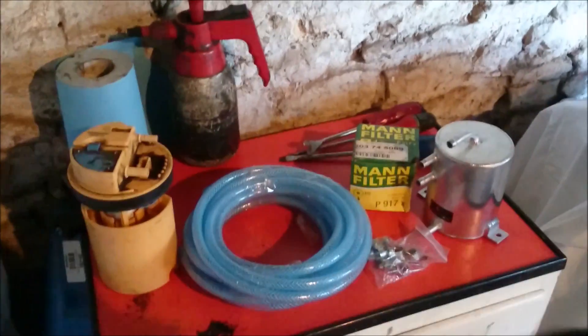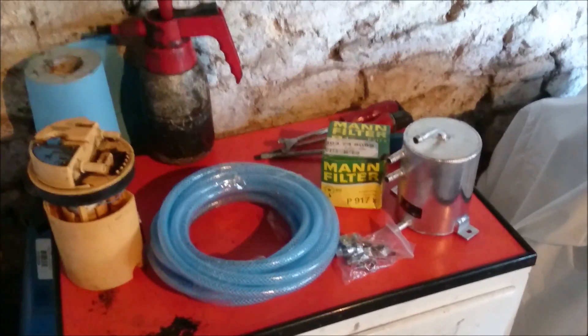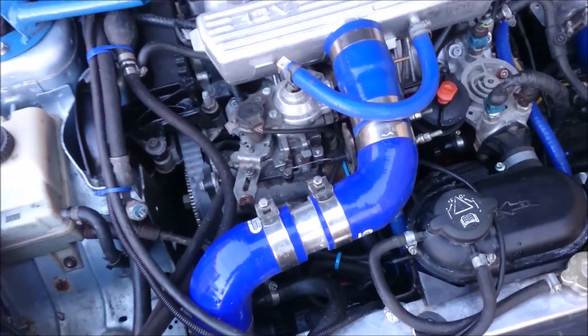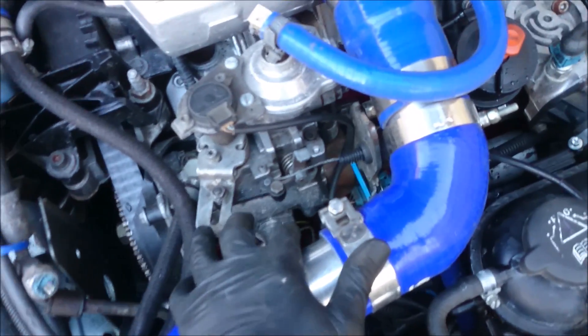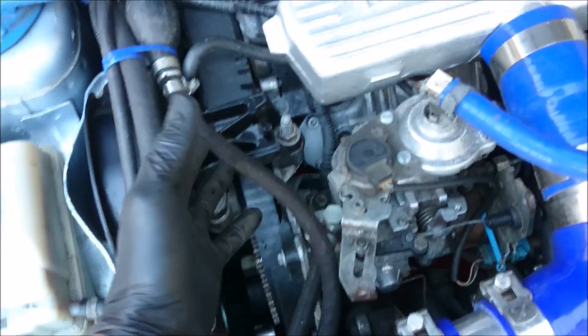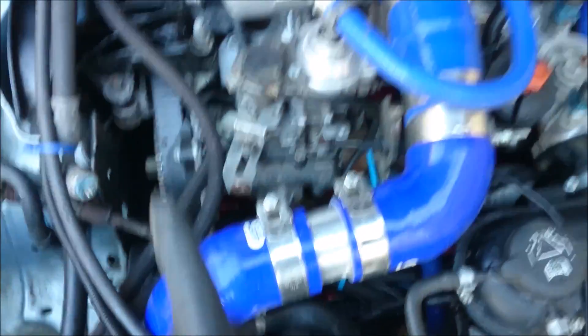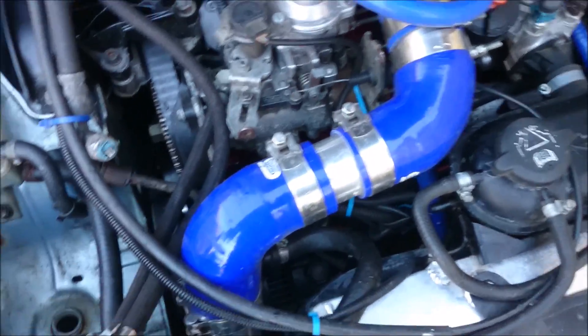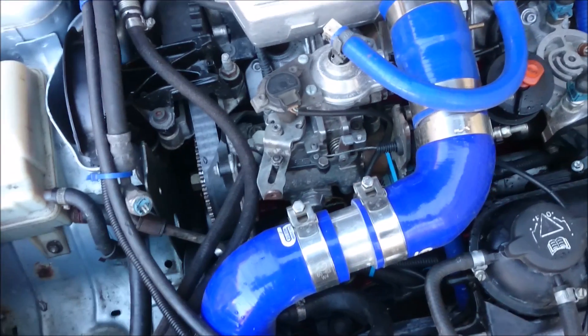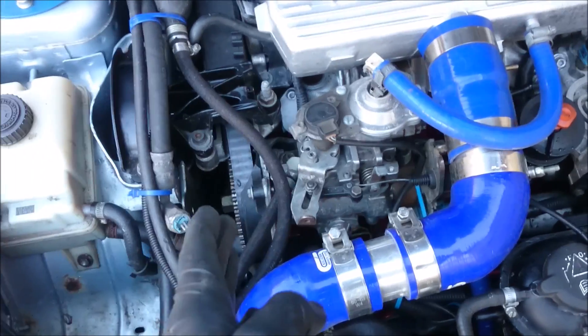And of course a pump. Currently inside the car, in the tank, is something that looks very much like this but without the pump in it — it's just a pickup. It's a VE Bosch pump — indirect diesel injection. It's got vanes inside it that create the pressure, and the vanes also scavenge. The fuel is just a little pickup in the tank and it sucks it up through the lines, through a filter, into the pump. What we aim to do now is reduce some of the problems it has in bringing fuel up — it takes energy out of the pump and affects the advance and other things. So the shorter distance the pump has to scavenge fuel and the less resistance, basically the better.